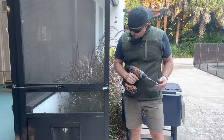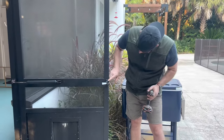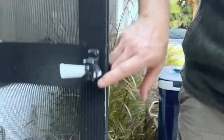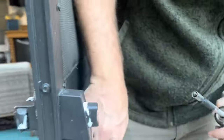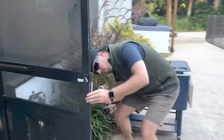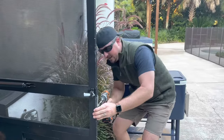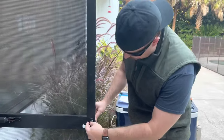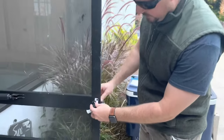There are just three screws to take out for the handle — one here, one here, and one on the other side right down here. You can use a regular Phillips head screwdriver or a power drill. Once you've gotten all your screws out, you're going to pull this apart. It has all sorts of parts in it and it comes out pretty easily.